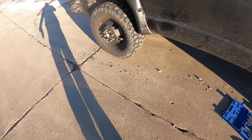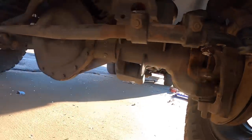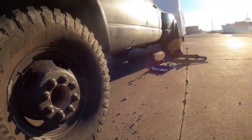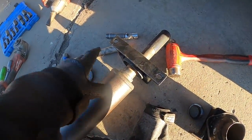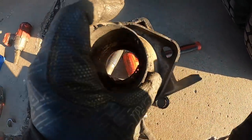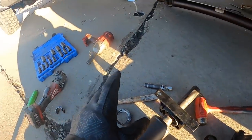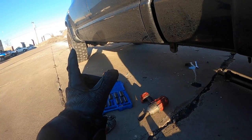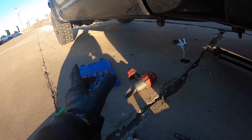I'm going to put this in the video anyway. After last night getting all this stuff cut out — I do know the front end is shot no matter what, so that needed to be done eventually. But I don't think that was actually my grinding noise. The funny thing is I usually check the carrier bearing religiously because of the issues I've had. I checked it before this trip and everything was fine — but now there are bearing issues, and I'd say I found my grinding noise. That front end work needed to be done, even if it wasn't the culprit last night.